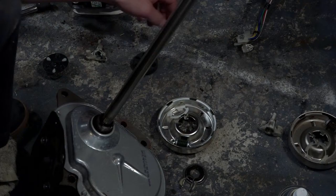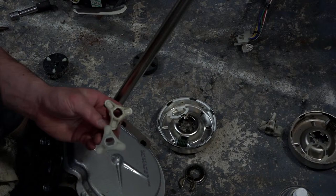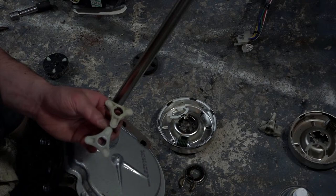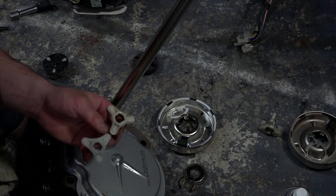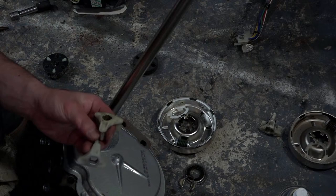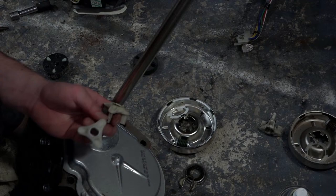With these plastic couplings, if you overloaded your machine regularly, you would break these. Well, then they came out with the metal insert couplings. 285753 is the plastic, and then they put an A afterwards for the metal one. But here's the thing. Once you put the metal one on, the metal is stronger than the shaft of the motor. So if you continue to overload the machine, eventually you're going to strip the shaft of the motor, and that repair is going to be hundreds of dollars for a motor versus $20 for a coupling. So I wonder if this was some devious plan by the engineers to get these direct drives off the market, because the metal coupling could theoretically destroy your machine if you continue to abuse it. So I don't know.